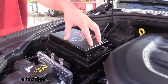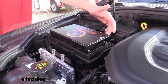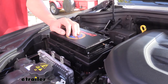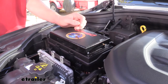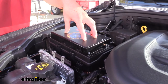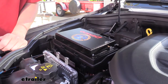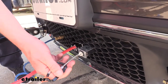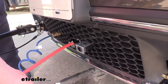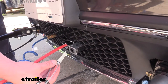The air is transferred to the cylinder on your pedal through our operating unit. The operating unit also applies vacuum to the brake vacuum system to ensure that when it's applying the brake pedal we've got vacuum assist, just like we would when the vehicle was running. It also acts with our breakaway switch to apply the brake pedal in the event of a catastrophic disconnect. At the front of the vehicle you'll see our breakaway switch — if the pin is pulled it activates the operating unit under the hood, which sends stored air pressure to the cylinder on the brake pedal to help the vehicle come to a safe stop.